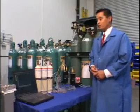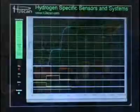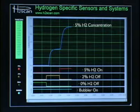This real-time serial data stream of increasing hydrogen levels is being reported every second and the response time is very fast. You'll see that the sensor's graphically plotted data is now leveling off, representing the hydrogen concentration in the exhaust manifold.